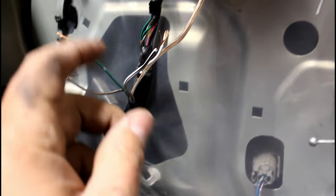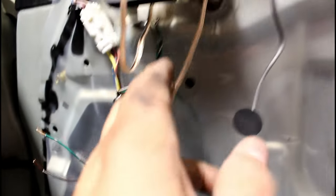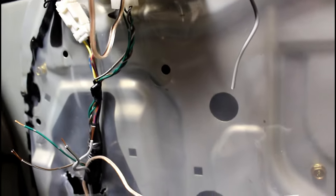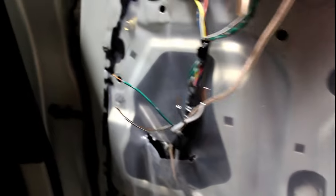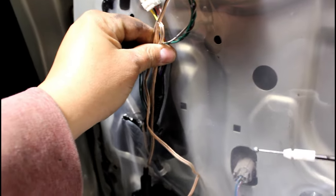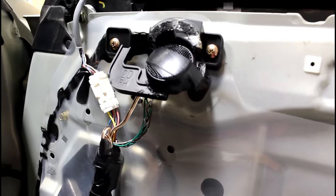After pulling the slack for the feed lines, cut them equal length, strip them, and crimp them together. The tweeter wire has ends on it so you handle that differently — the extra wire can go away. Plug in the tweeter wires — they're long, so use this as a tie point: lift it like that, then bend, fold it, fold it, fold it, and tape it. That's what I was talking about — just fold it a bunch.